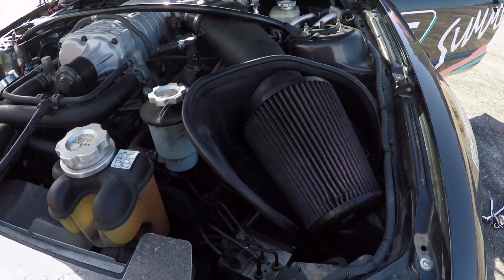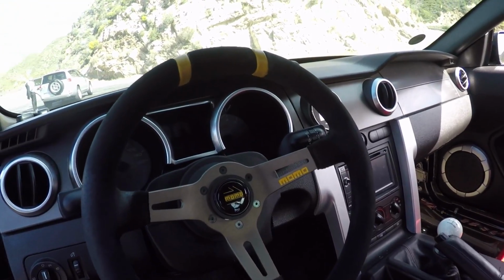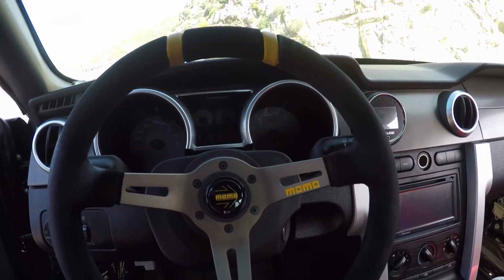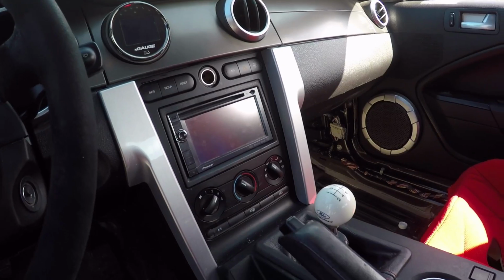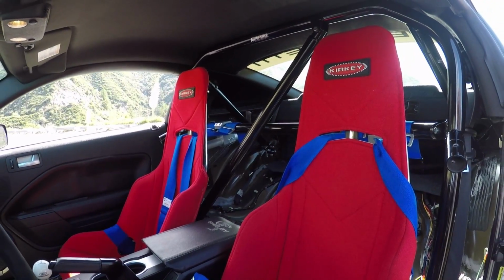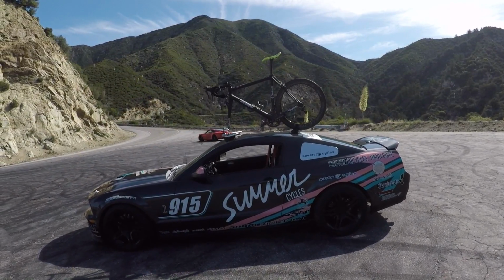But through working with folks like Sam Strano at Strano Motorsports to really tune the suspension, we've kind of made a pig that can dance a little bit, I think you'll find. It's still nose heavy. It still is a big iron block V8. We did address some power issues with it too by putting a bigger supercharger in it. And we addressed the cooling, which is very important. That's what people get concerned about with roots type blowers, obviously, heat soak and just forced induction in general. But you can address it, just put a big heat exchanger in it.